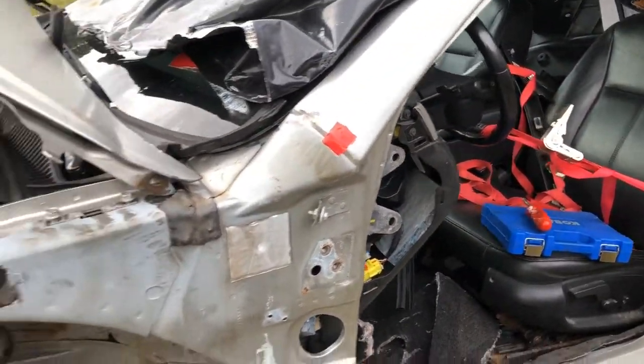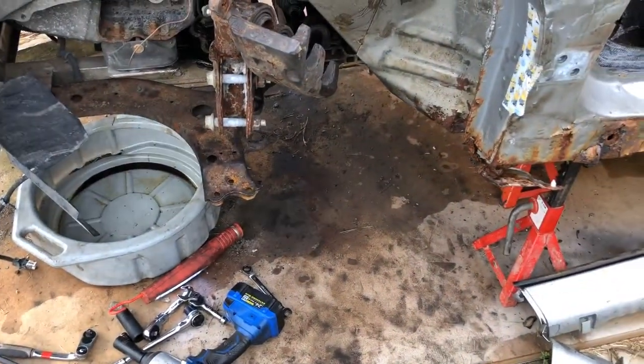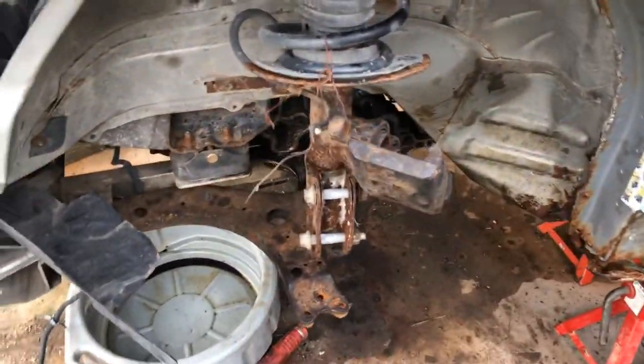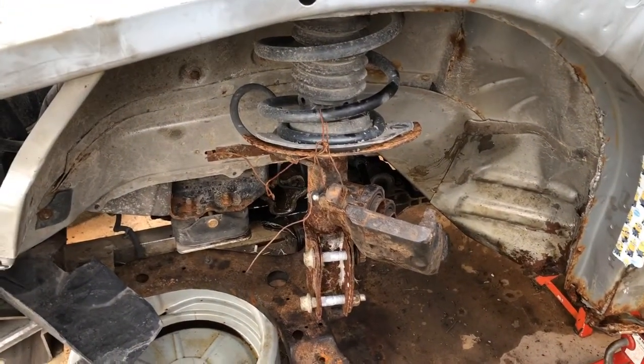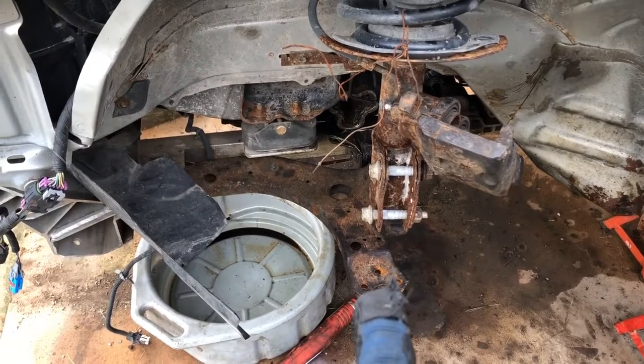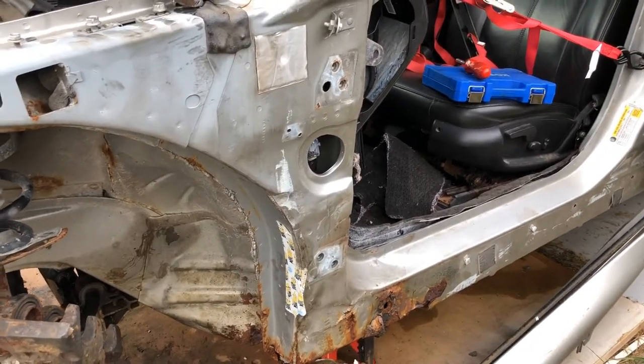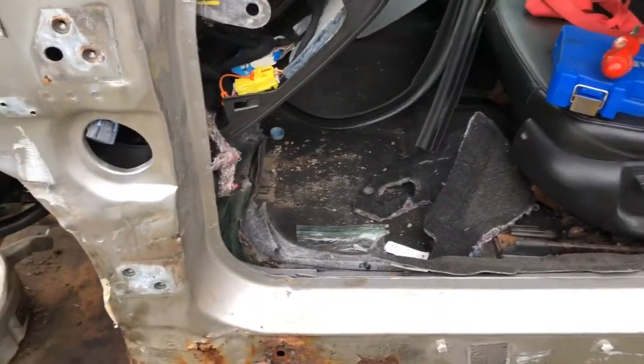Keep the clock spring in a straight position as well. As you can see, it's not much fun working out here in the yard — not very comfortable laying on that — but we got it done. That was probably the hard part. Next we'll put on the ball joint and the knuckles and get the suspension tied back up so we can get it off the jack stands and on the tires, and then maybe see about straightening this A-pillar corner of the car.